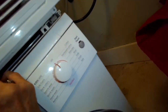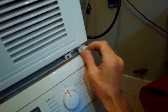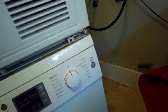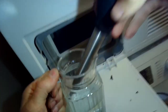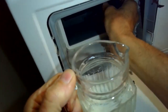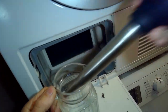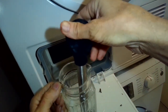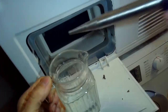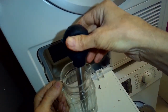So I'm pushing the washing machine back into position. So just pushing in these little plastic clips, they just lock into position and they hold in the front feet so the washing machine won't move forward. And I'm just putting in a little water into the sump to do one more test. Oh, and there's also, after we put in those 2 plugs, there's like a trim piece that you slip in that goes between the washing machine and the dryer. It's mainly just a nice aesthetic piece.